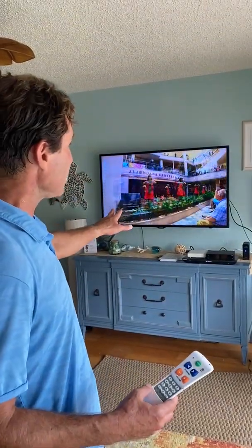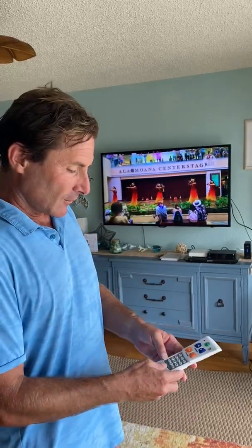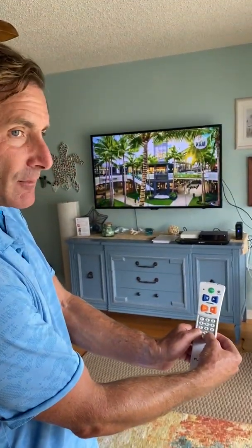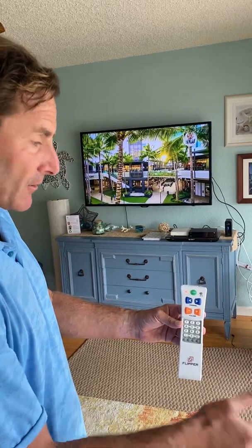The two channels I'm going to use are channel 1050, which is a Hawaiian vacation excursion scenery channel, and the other channel, unfortunately, is going to be a news channel — so we'll just toggle back between the two. Press and hold STB and Add at the same time until the light turns solid. It's important to press at the same time, otherwise favorites will not be programmed.